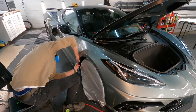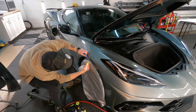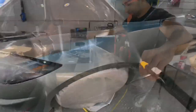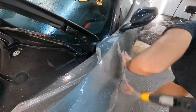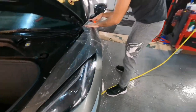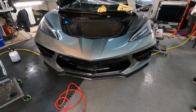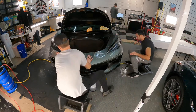Sometimes we do minor disassembly. Major disassembly is not recommended, especially with a new car, working with warranties, but we pick and choose what we will disassemble. The passenger side fender is finished — it doesn't take long to jump over to the driver's side. Now we're spraying on our slip solution, which is simply a mixture of Johnson & Johnson baby shampoo and water. That floats the film on top of the panel and doesn't let the adhesive make contact with the surface so we can adjust. Alignment is key — you want to be quick but take your time, do your alignment and tack points first, then squeegee out all of that shampoo so the adhesive makes contact and the film adheres to the panel.